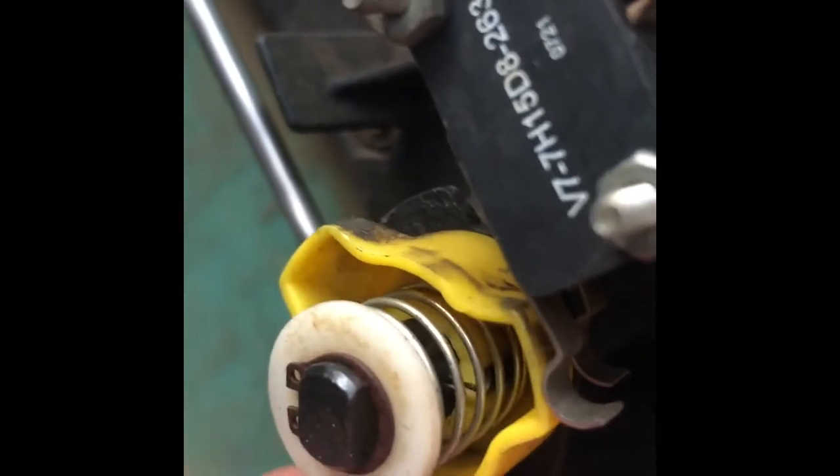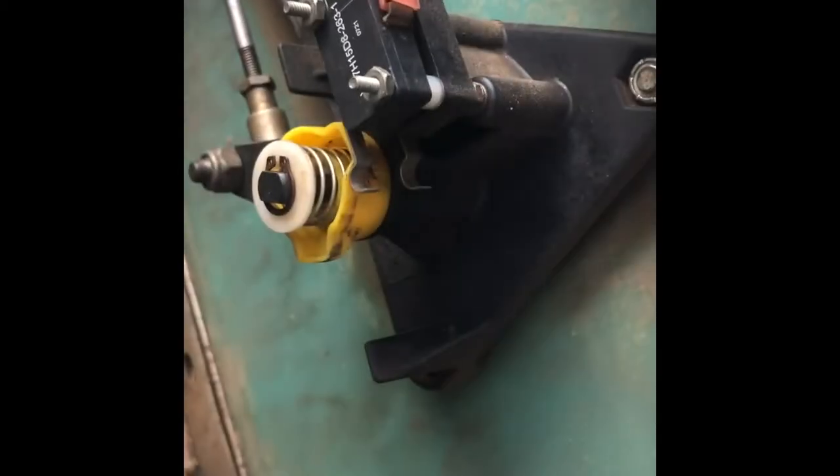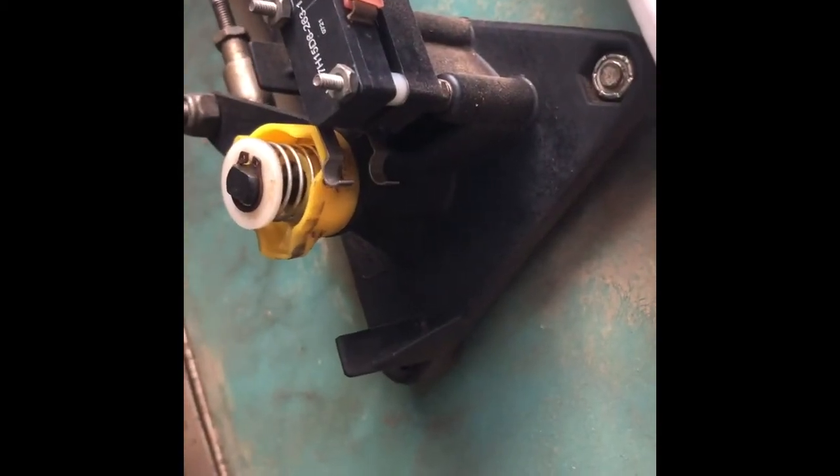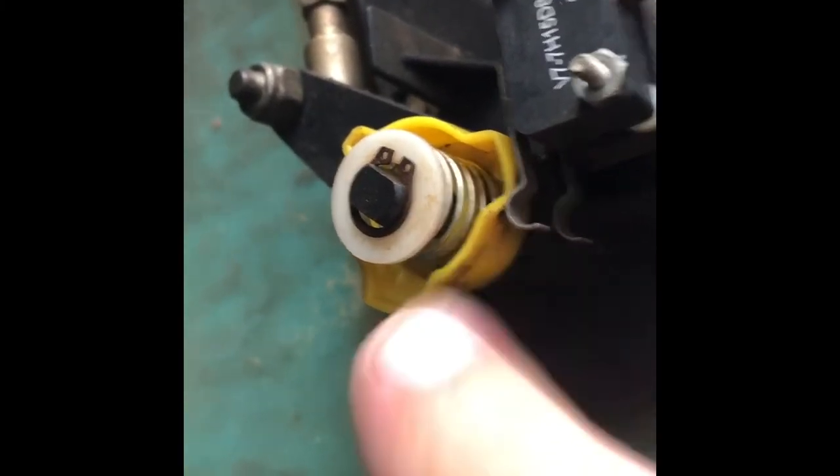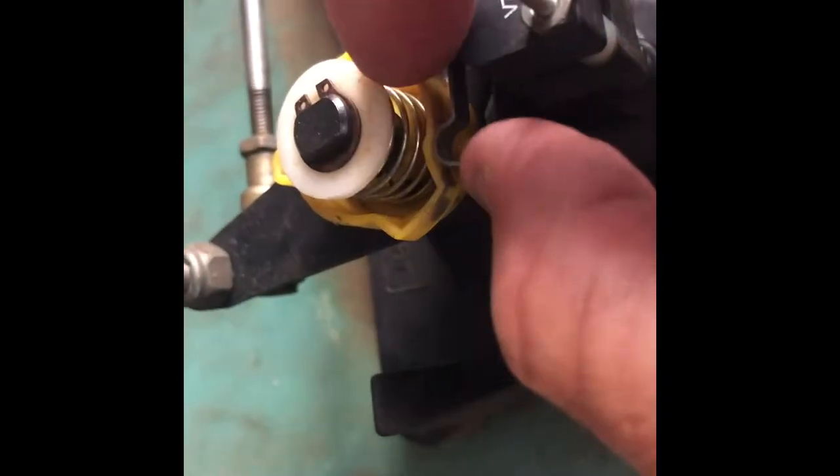There's a tonne of play in that. You can either replace that gear or you can bend these micro switch arms slightly down, away from it, like so. Just bend that arm ever so slightly down. In reverse you'll hear the buzzer — it's not quite engaged — force it over harder and there, it's clicking. I'm just going to give that little shaft there a tiny bend. If it's really bad, go and replace it. It's just not activating that micro switch.